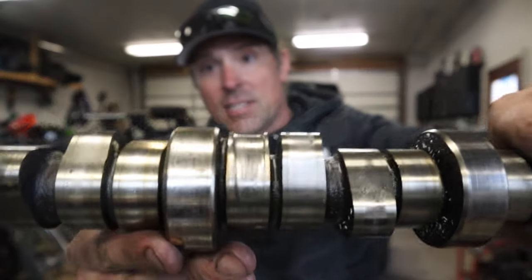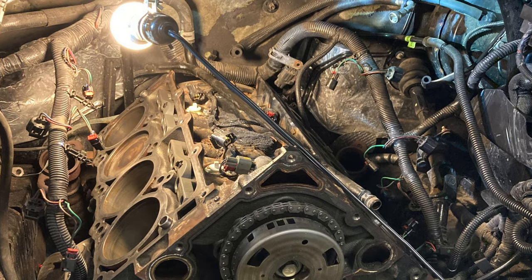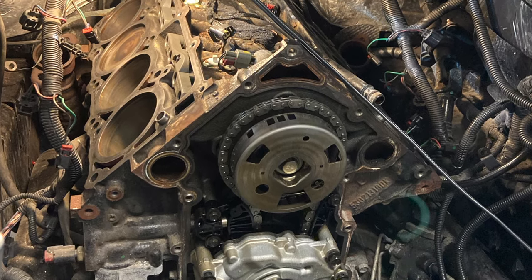There are a couple other things that are common with these. Why do so many people have to take this project on? One of the reasons is right here — this is a cam from the motor, and you can see it flattened the lobe right there. There's a lot of speculation on the internet, from lubrication problems to different ideas, but it seems to be a lubrication issue. Some people state this isn't just on MDS motors — it happened on some other motors as well. Regardless, mine was an MDS motor where a hydraulic lifter flattened the cam lobe, which resulted in a bent push rod.